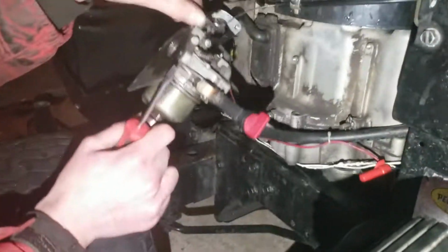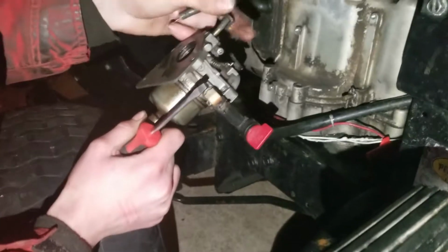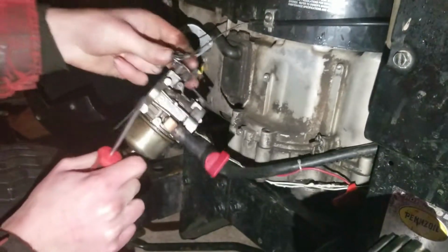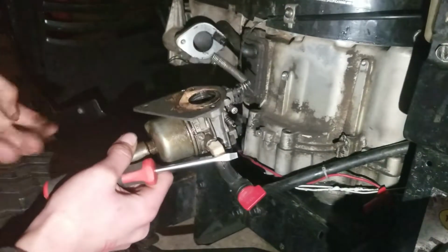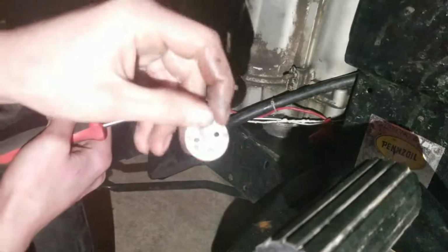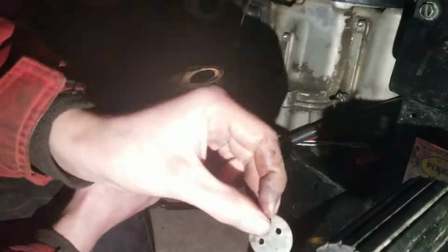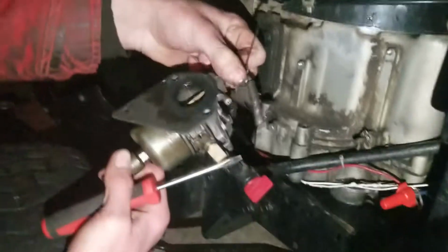You always want to make sure that you're putting it together right. Okay. Make sure you have that little flap there for your idle screw, or else that will mess it up. Okay. So now this goes together a certain direction too. Your bolts, you'll have these little tabs here, these little fins. Those are going to go on to the shaft side, and then those opposing ones without the tabs, those will have the bolts go through it.